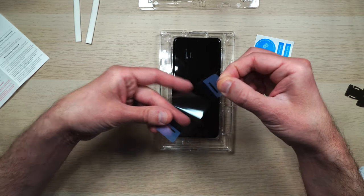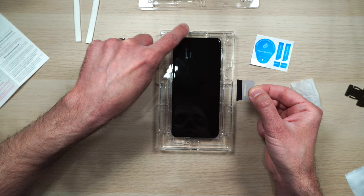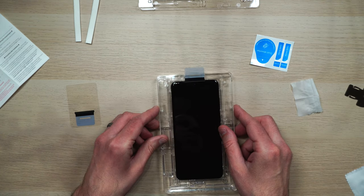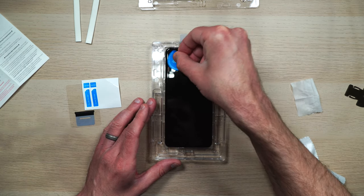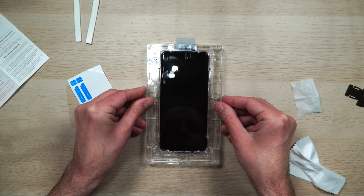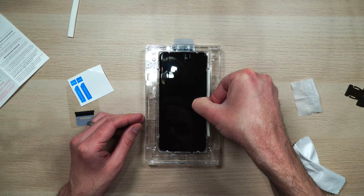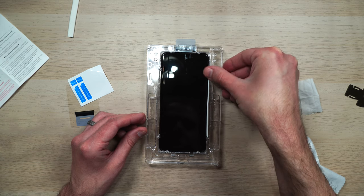If you look at these little stickers, they have a little cutout, and on the top there's a little cutout for that. So we're going to go ahead and line that up — that's evenly covering the speaker. Now that that's aligned, we'll go ahead and get any dust off, then put the top tray down. That's fitted over there. Now we're going to put the absorption pads on the sides — let's push those down, make sure those are touching the phone.